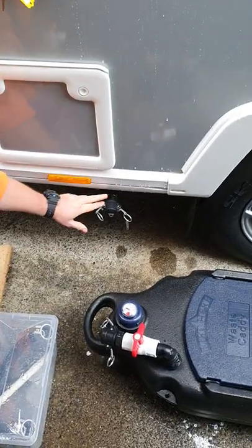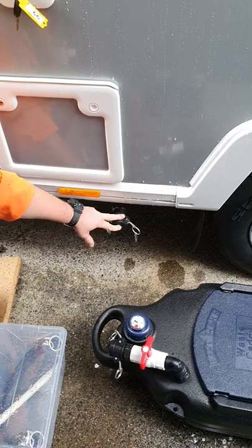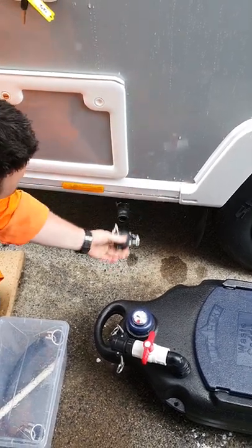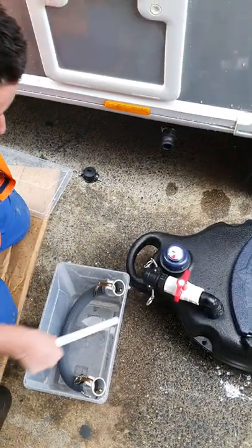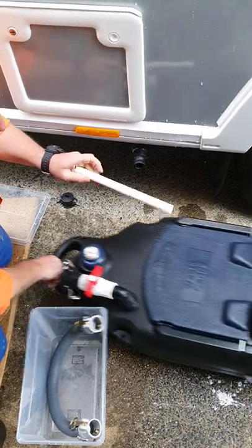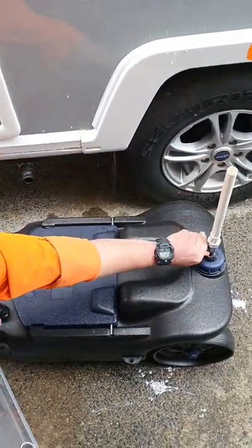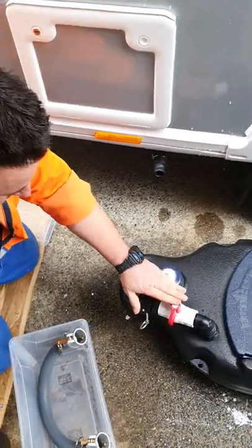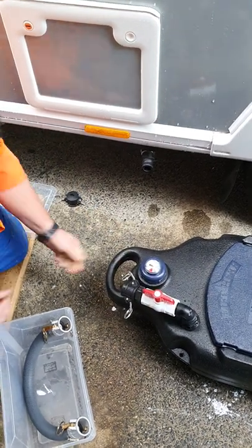But just behind your wheel here, this is your self-containment greywater outlet. You've got a little cap there — these are where your arms undo — and that opens up there in your little container here. This is your breather hose, so that just goes on the top of there. Make sure that valve's open, facing like that. You've also got a valve on this end, so that's in the open position there.